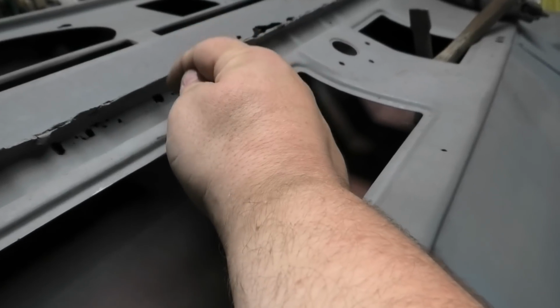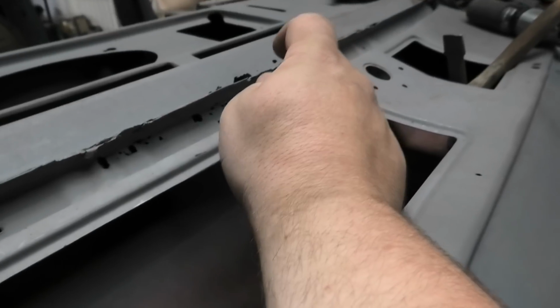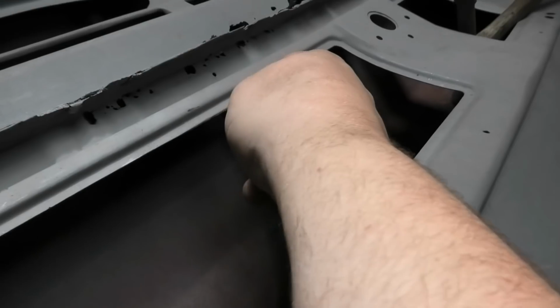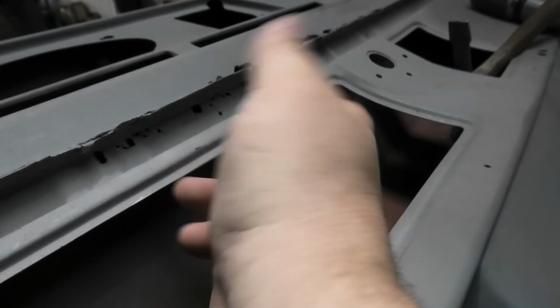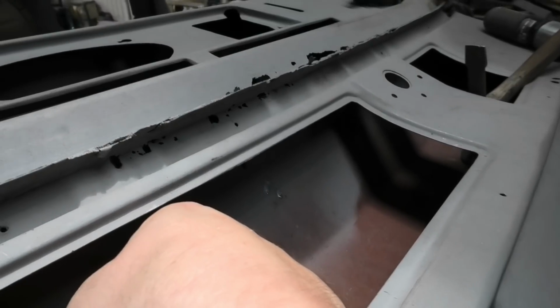And then what I'm thinking I might do is then just cut the lip completely out, not even bother about trying to split the spot welds for now, and then focus on rebuilding the inner piece first, which is basically up and then goes like that. And then you can stick this piece in, and then this piece. This is going to take a bit of time and a bit of doing.